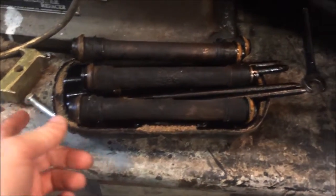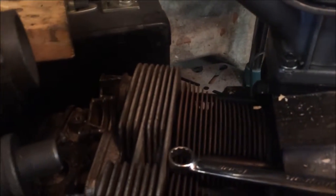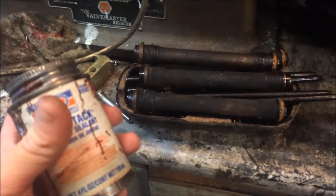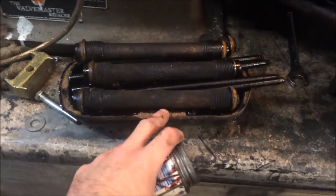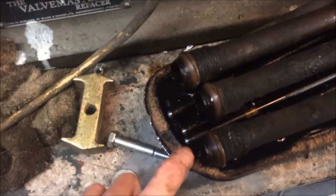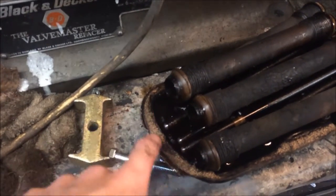There is still oil on it, so I'm getting new piston rings - just ordered them - and some new push rod tubes, new push rod tube seals, and new rocker cover gaskets. I've got other rocker covers. One thing I do like is this Permatex high tack gasket sealant. It seals these rocker covers which are prone to leaking. You use some of this on the head, then put the gasket in the rocker cover with more high tack on the backside.